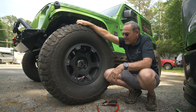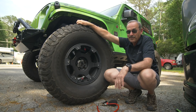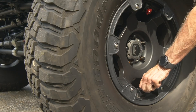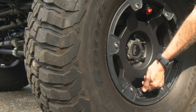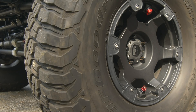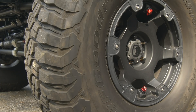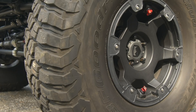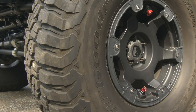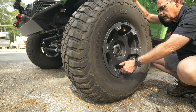I have my Nomad set to 15 for all of the above reasons. Here's a little trick I use when I set my wheels: as you air down you'll notice a quick pulsing sound as the air is released, and when that pulsing sound stops the air will continue to hiss out for a short while until it completely stops. I set my deflator so that when that gushing air sound changes from the pulsing to a slow hiss, I then shut the valve. At that point the pressure is set to 15.